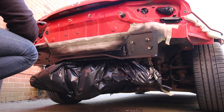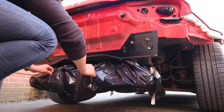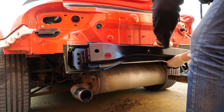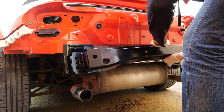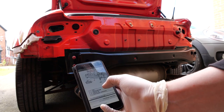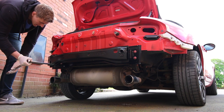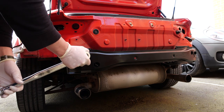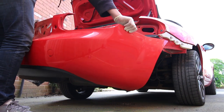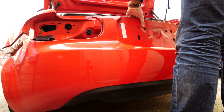I didn't film all three coats because it's pretty much like watching paint dry. Remove all the masking tape off the car and you are left with a lovely Hammerite painted finish. Now we're on the reassembly stage — everything bolts back up exactly as it was removed, apart from this time it looks a lot shinier. For the torque on these I used melons.net — torque for these nuts is between 37 and 52 Newton metres, or 27 and 38 foot pounds. Then I tried to put the bumper back on but obviously I still had those wheel arch liners in place, so I wrestled with trying to get the bumper on.